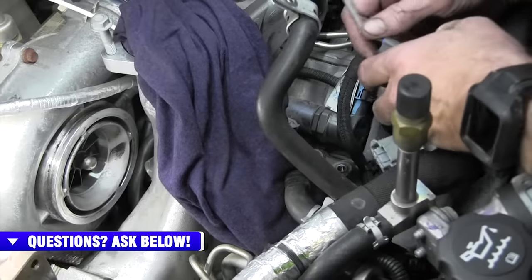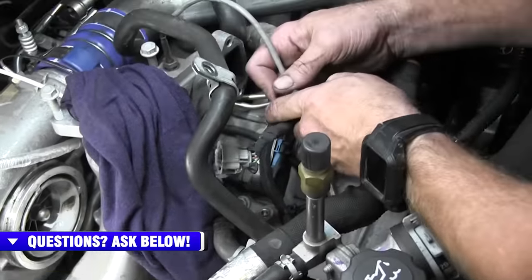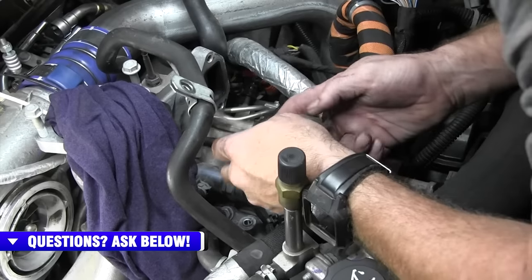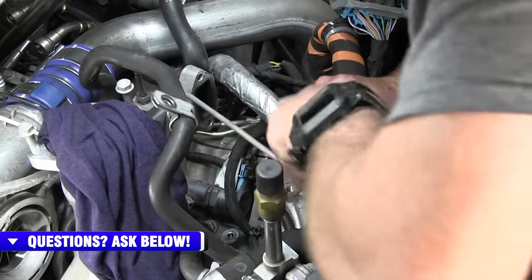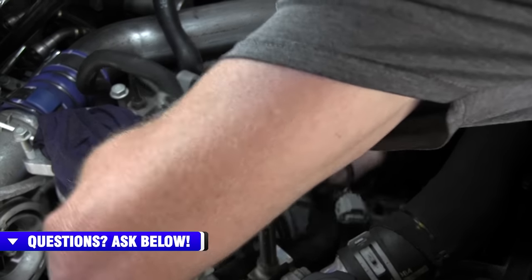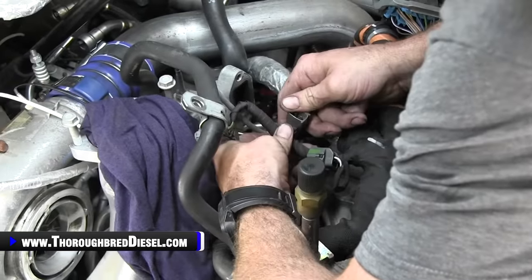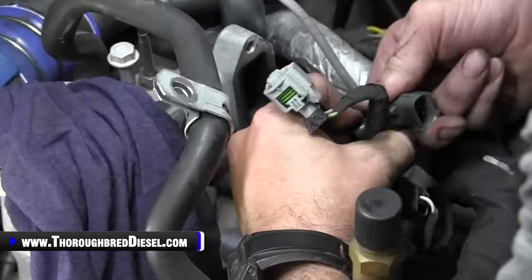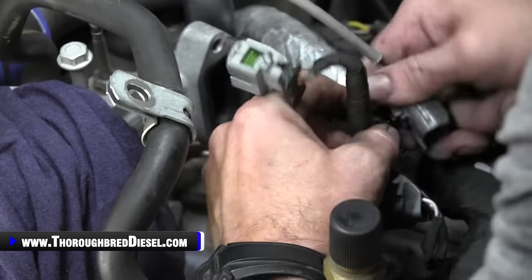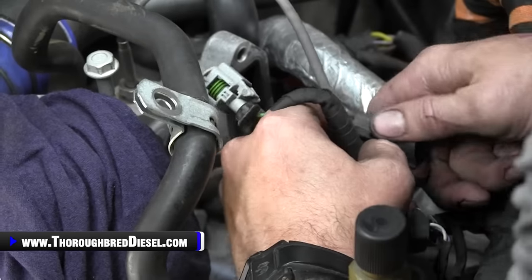All right, we're gonna go ahead and lift our Y bridge out. Before the Y bridge comes out, we've got to unhook this temperature sensor. So this little green connector right here, just push it down, it should separate. And then it is attached to the wiring harness as well. So what we can do there is pull straight up on the thing or release it from the mount.